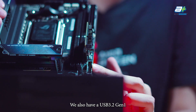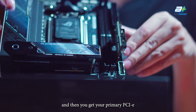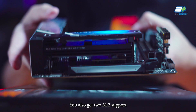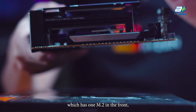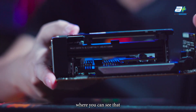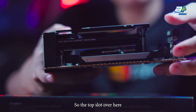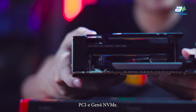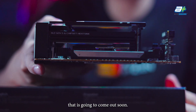The add-on also provides USB 3.0 front panel support. The motherboard itself features a primary PCIe Gen 5 X16 slot for your graphics card, as well as two M.2 slots. Unlike many ITX boards that have one M.2 on the front and one on the back, both are on the front stacked in a sandwich style. The top slot supports PCIe Gen 4 NVMe, while the bottom slot supports PCIe Gen 5 NVMe.